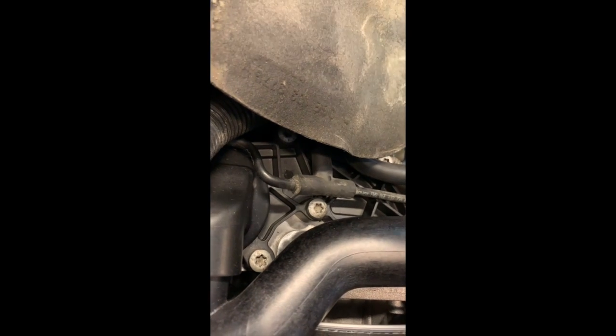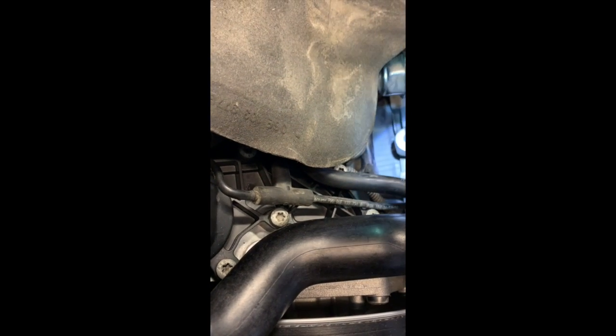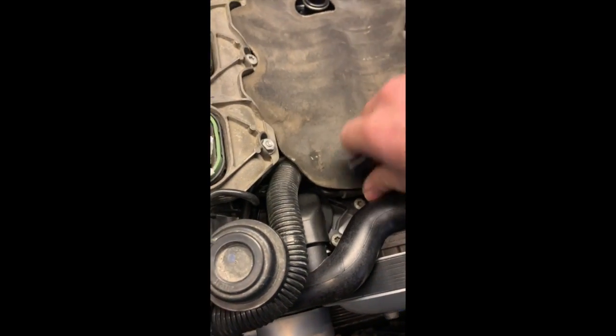Also, all of the intake valves, as you know, have been cleaned. While the intake valves were cleaned, the intake plenum was out. I did take the opportunity to replace all the seals, the spacers, and the O-rings on the injectors because I bought the whole kit, so I decided if I got the kit, I'm going to replace all of it. Also, they had clips that go right on the top.